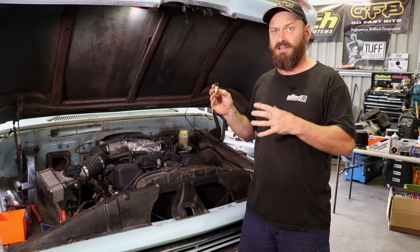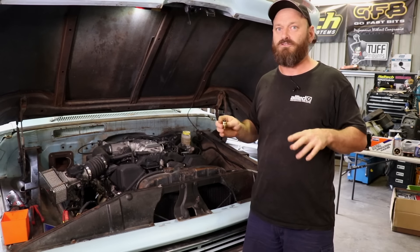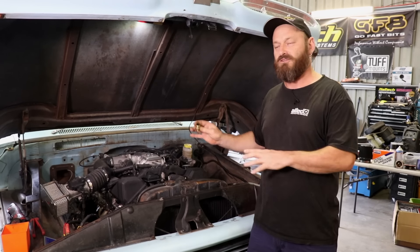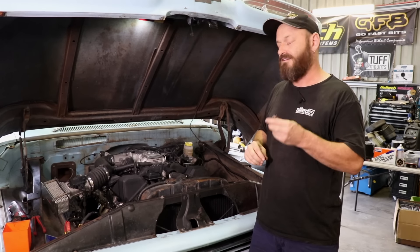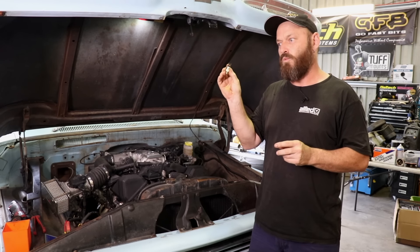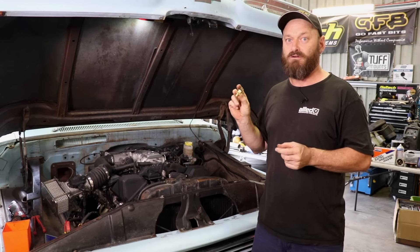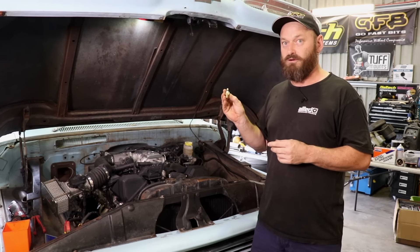Also, a lot of the off-the-shelf stuff for V8 engines is much too low for a modern engine — they want to turn the fan on at 85 degrees. It's basically just going to turn it on and never turn it off, because that engine does not want to run at 85 degrees; it's not built for that. So you've got to pick the right temperature range. There's actually higher ranges than this — I think there's a 101 that turns off at 95, and there's a lower one as well. This one works pretty well with modern Japanese engines, so that's why we always used it.